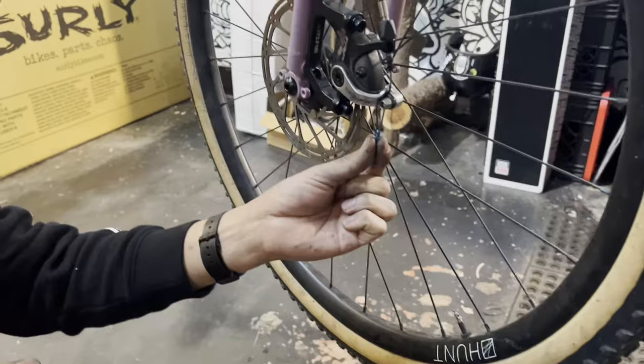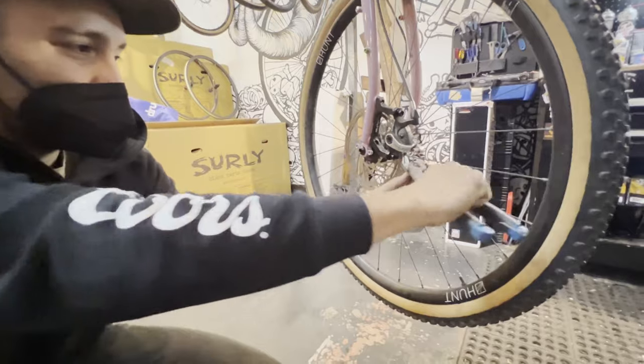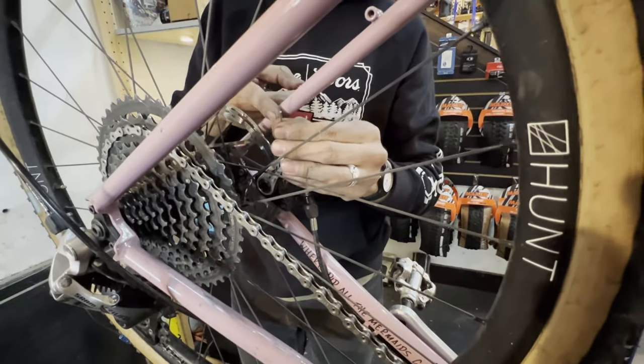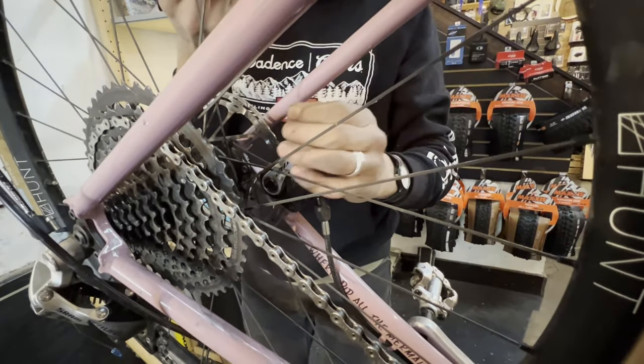In the box there are two cable cherries held together by a small piece of cable. Also in the box is a one millimeter hex wrench, which Lahey told me is really nice because most hex wrench sets do not come with a one millimeter wrench. So if you're replacing the crimp on the end or if your cable is already frayed, just snip that off with the cable cutters. You just gotta trim this up and try to get as clean of a cut as you can because if it's fraying it's gonna be hard to slide this on.